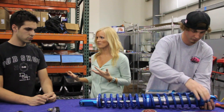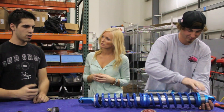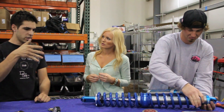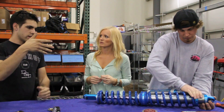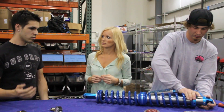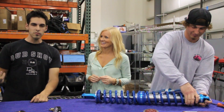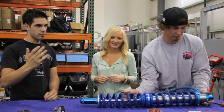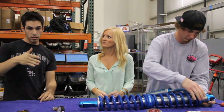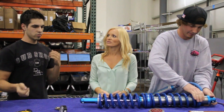What are some consequences of having the wrong preload? If your springs are too soft and you have a lot of preload, you're going to have a lot of pitching in the car when you're on the brakes. That's a trait of a linked vehicle on long travel anyway, and it'll be worse — more visible to the point where the car just looks goofy when you're on the brakes. Also, when you have all that weight transfer so extreme, you can lose traction in the rear. If you're braking, the rear end can get loose. If you're accelerating and it pitches back, you lose steering.